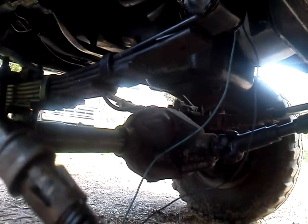But yeah, that's what I'm working with right now. Got my downpipe coming right there. That's just temporary. But my drive shafts are hooked up. And I need to get a locker for the front and some different running gears. I've got 4.56 gears in the front and 4.10s in the back, and I'd like to keep the 4.10s and just get some different gears for the front, which I don't think would be a big deal. And I'm thinking about putting an air locker in the front or an electric locker, probably electric.